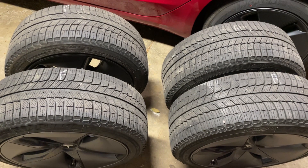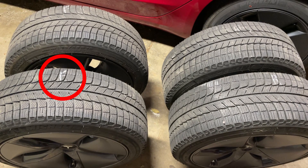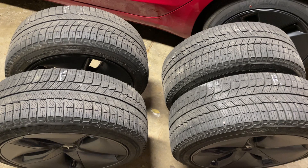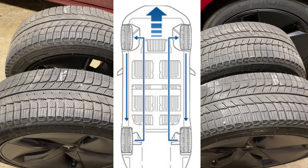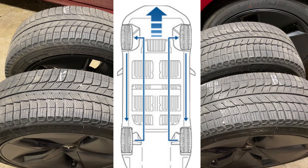In my case, you can see that I have some tires that were used last winter, and that they are marked either front or rear, indicating where they were on the car last year. So for this year, it is best to rotate them to help spread out the wear evenly. Tesla recommends same-side tire rotation, so tires on the left side stay on the left side — you just move the back to the front, and vice versa. Similar for the right side.